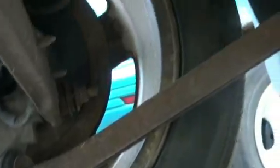Looking through the wheel, it's about straight across from there, and there it is up there. On one side there's a quick disconnect. On the other side there's a threaded fitting. Typically a good idea to have a flare nut wrench for this, especially on the nut that's going to stay with the car.